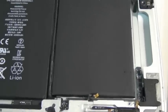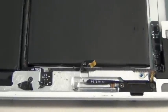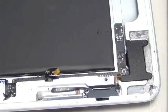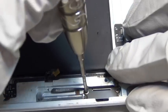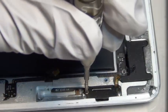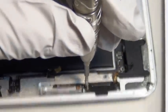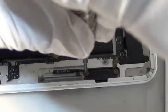What happens here is a customer sent in an iPad 2 with a ripped ribbon cable. This can happen when you're not careful, or there's too much glue on the glass digitizer, and when you're trying to take it off, oftentimes it gets ripped apart because these cables are designed to be so fragile. When you remove the LCD glass, this can happen, and as a result your volume button and more importantly the power button for the iPad will not work.